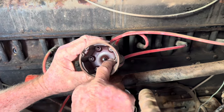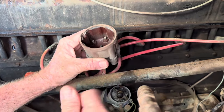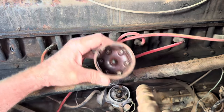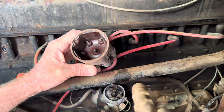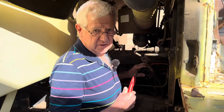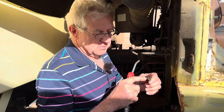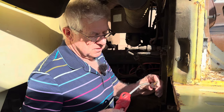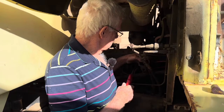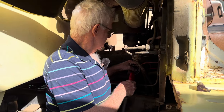I'm always suspicious whether there's carbon lying around in there off the carbon rod in the middle — see how there's dust and junk sitting in there. Stuff like that can actually short them out if it gets bad enough, and I haven't checked the points to see if they're opening, but it's still got points in this motor, which I'm surprised about. It might have had something electronic on it by 1978. Check the points and see if they are opening or whether and how burnt they are. Sometimes these distributors can get carbon dust inside if the carbon rod wears — some people sand the top of the rotor button, and if they do that it'll wear away the carbon. I can see where someone's had sandpaper on that — you can see the carbon dust lying around on top there. I always put my finger over the carbon rod so it can't blow out — otherwise it'll just go straight into orbit and you'll never see it again.